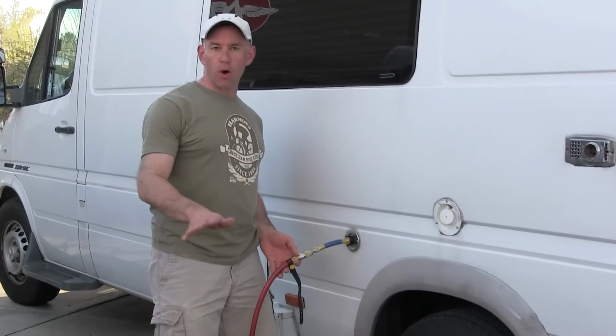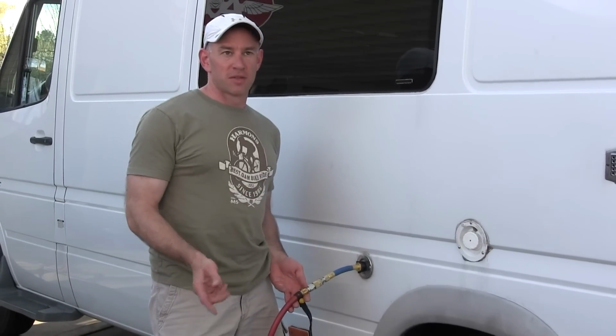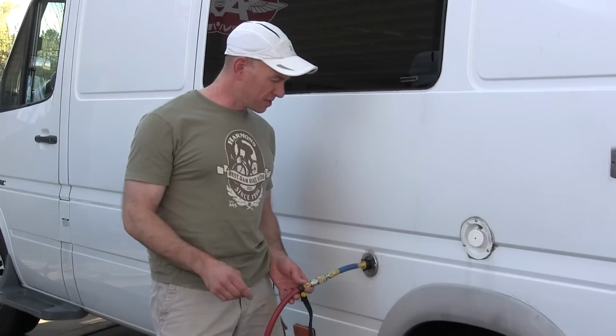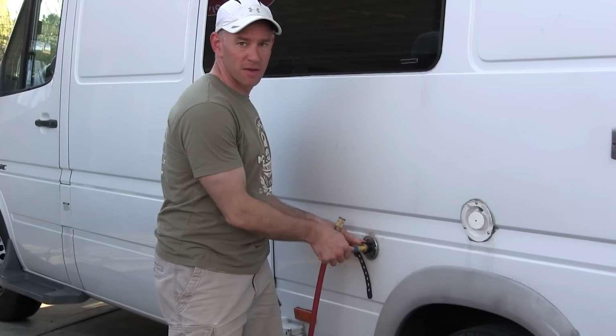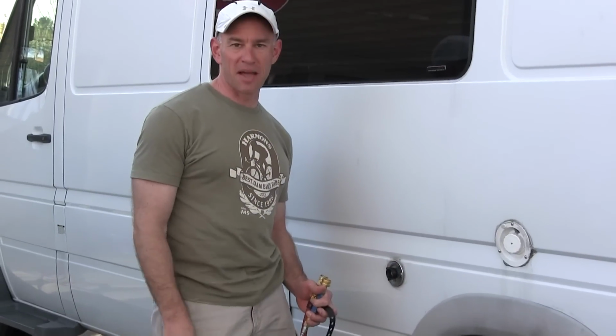All right, all the water lines are blown out. I opened up every single sink, both hot and cold, shower, even the toilet. Make sure you don't have any water left in that, or it'll freeze. So now I'm just going to disconnect the air, and we're on to the next step.